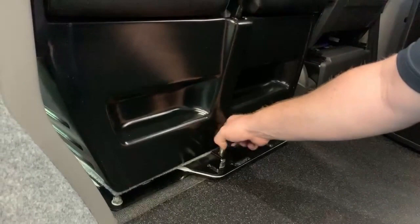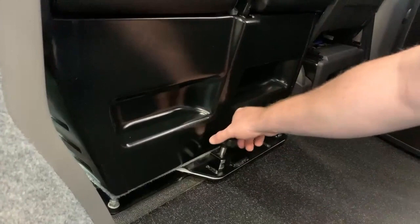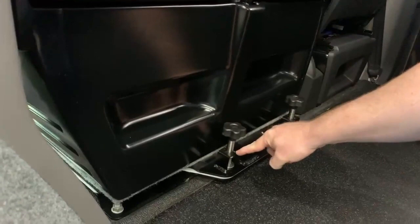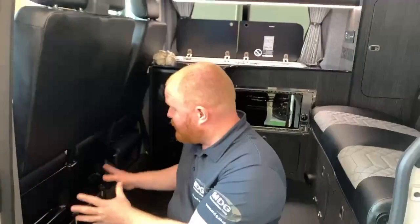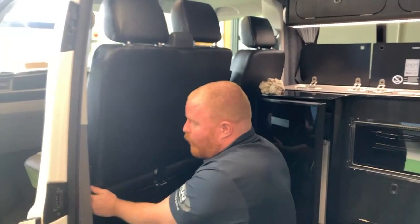There's one at 180 degrees from it on the opposite side. As we unwind these bolts, the bolt will then become loose. At the very top of the bracket there are two cutouts at either side for those lugs to pass through. I'm going to lift up on the bolt against the bracket, rotate until the lugs pop through those holes, and then continue to rotate so that the lugs sit on top of the bracket, preventing the bolt from falling back down. Once you've done all four bolts, you are now ready to move the seat. Make sure first of all you don't have any seat belts or anything caught on the headrests that could impede the movement.